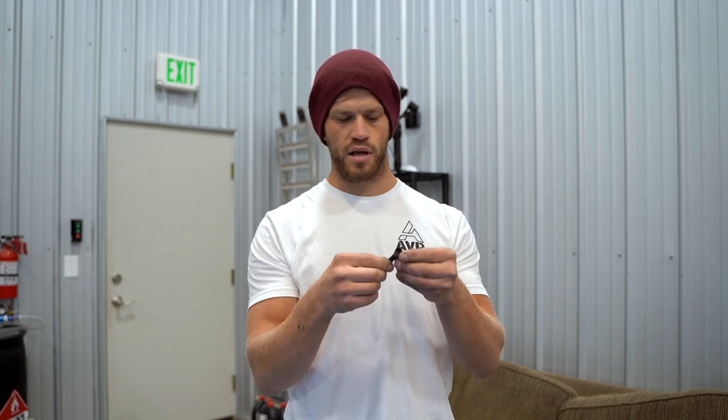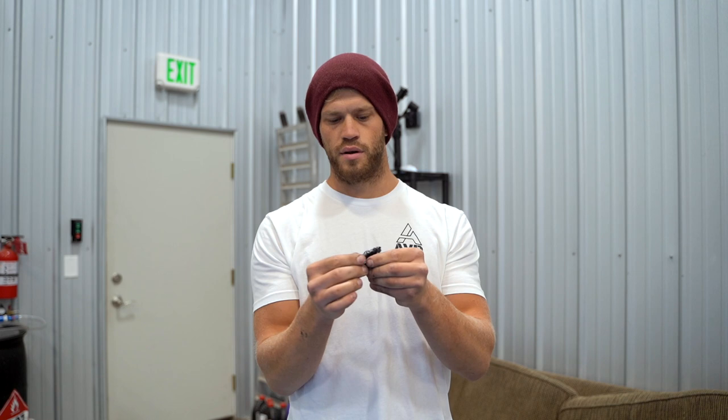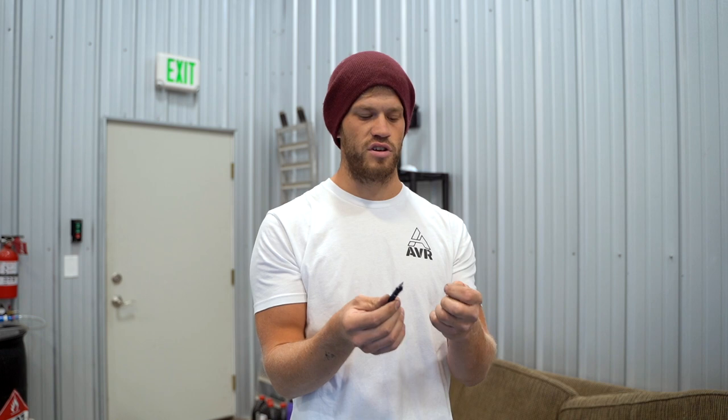So I pulled the whole harness off, checked continuity — it was good, the wire appeared to be connected. Put it all back together and there was no continuity. I wiggled it around and it would connect, disconnect, connect, disconnect. Tore the whole harness apart and found that the wire running from the alternator up to the fusible link had this little extended splice in it — kind of soldered together very ghetto. Basically with no tension on it, it was fine, but as soon as the car was back together it would just separate. Pulled on it a little bit and it completely fell apart. Got it connected properly, 100% good to go.